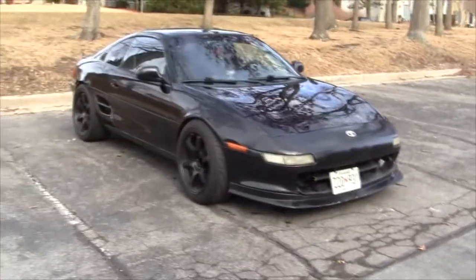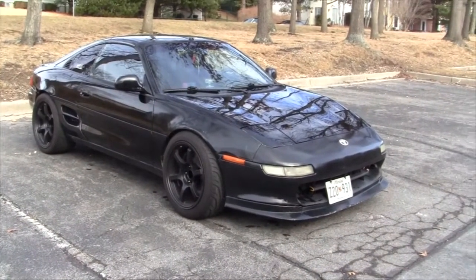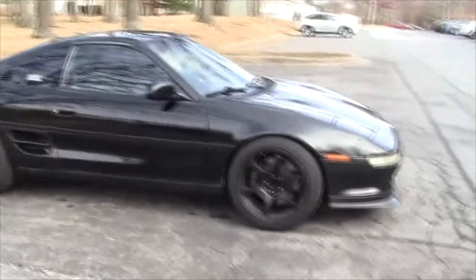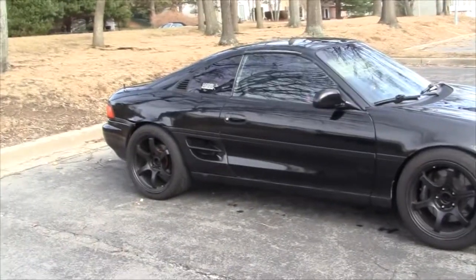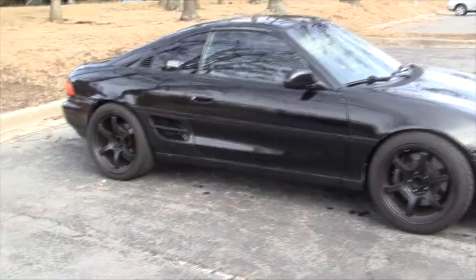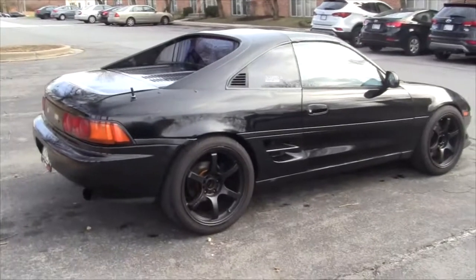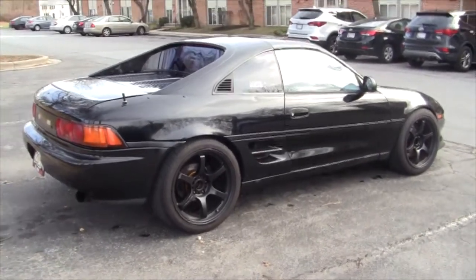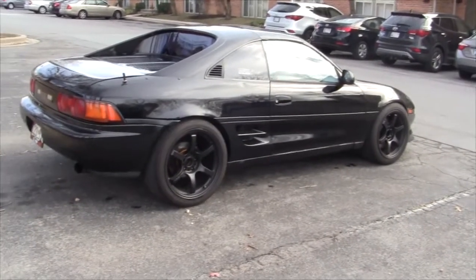This car is actually going into the garage today. Basically this car is a pretty simple car and that's kind of how I wanted it to be. It's a '91 SW20 chassis with a 3SGTE stuffed in it, with a CT27 side-mounted intercooler — all that jazz, all the bolt-on stuff. We're running 93 octane gas out here, and on 17 pounds it makes around 300 horsepower — if it makes close to that, that's fine.